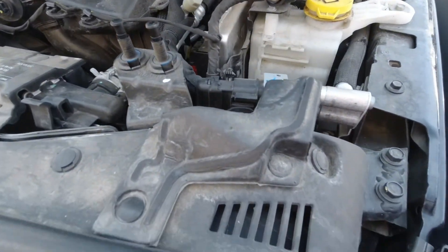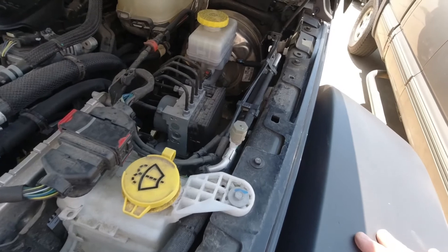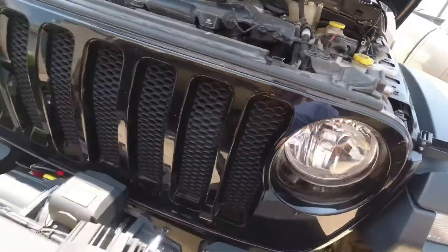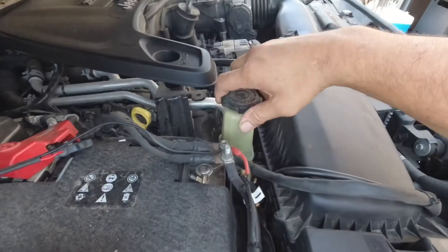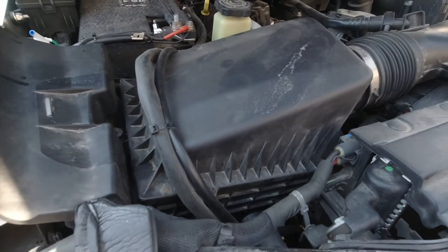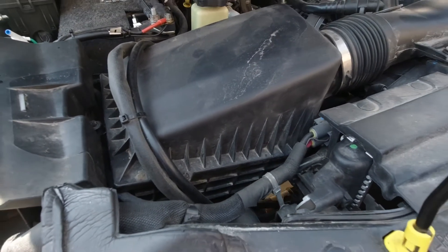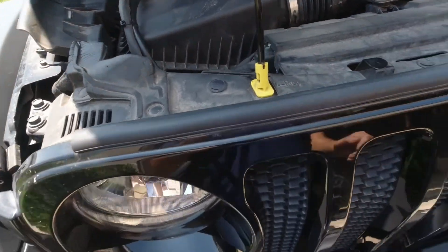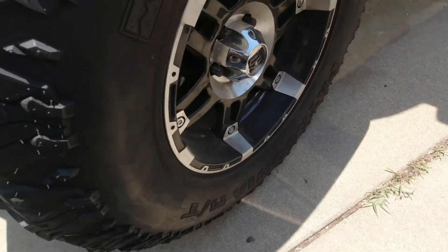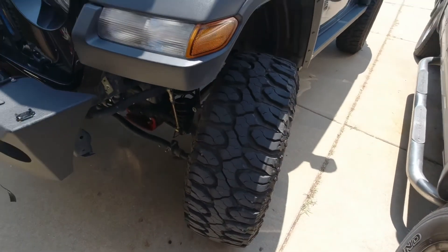Once you wash up, check your brake fluid to make sure you still have some. Check your overflow bottle for antifreeze. If you're running larger tires, check your power steering — you'll need to periodically depending on the trails. Air filter: we change that out about every 5,000 miles, which might be a little excessive. Go through and retorque your lug nuts, and with big tires you have to rotate them quite regularly — we rotate about every 2,000 miles.